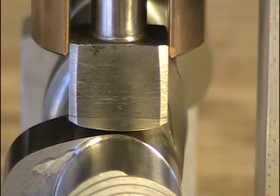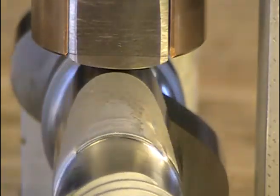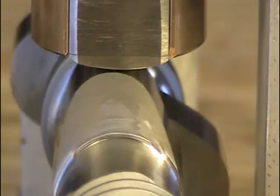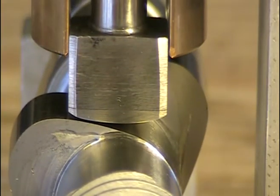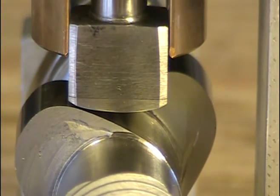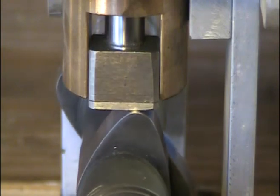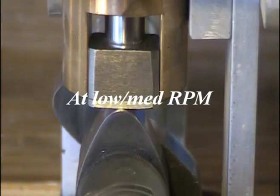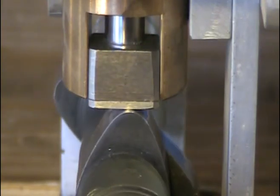It's the radius of the BSA lifter that keeps the edge of the lifter from hitting the cam lobe — see right there, it doesn't hit the edge. The only time the cam lobe touches the center of the lifter is at peak lift. This is where the valve spring pressure is the highest and it's where most of the cam lobe wear occurs.